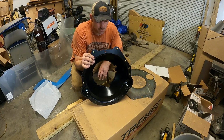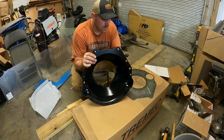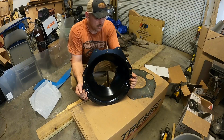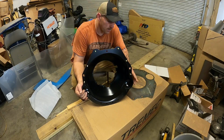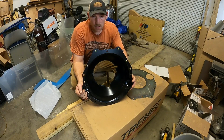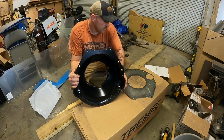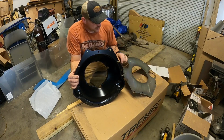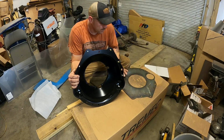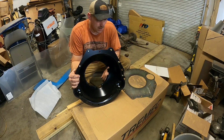Chevrolet, or your small block Chevys, had the different bell housing pattern. But it offers you a multitude of different things, because I don't know if it was a Buick or a Pontiac that had the starter on the other side, but the Caddies were over here. And then it comes also with a scatter shield plate, so God forbid you blow something up in there, like your flywheel or your clutch, it doesn't come through and damage your block.